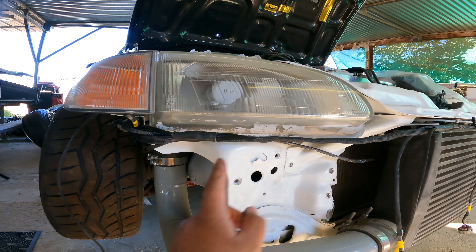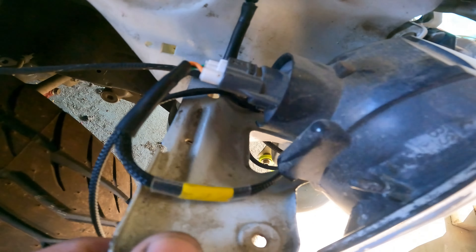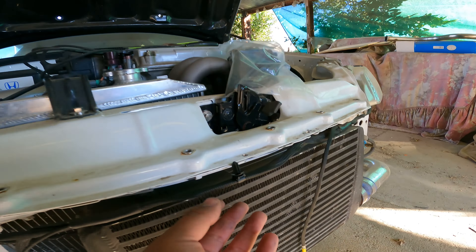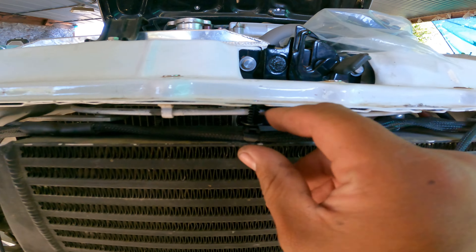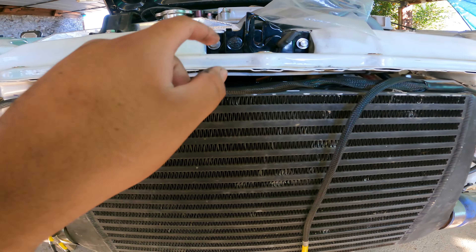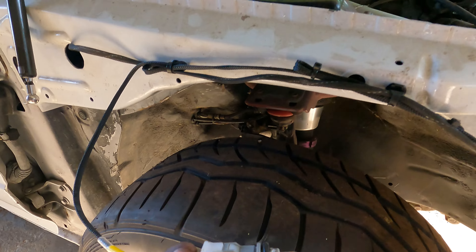So I got a chance to get some more wrench time in on the car. What I'm doing is going to route the harness. I got it all bunched up under there and then up top you can't really see it. There's a city light, headlight, corner light, ground. I just use this bracket - I fed everything through the bracket there and the corner light through this hole, and just zip tied everything with a push lock zip tie. It's all mounted right there. I might have to drill the hole bigger. But you guys get the idea - I'll drill these two holes bigger. What I'm going to do is route the harness, hard mount it, and then clean it up from the inside.